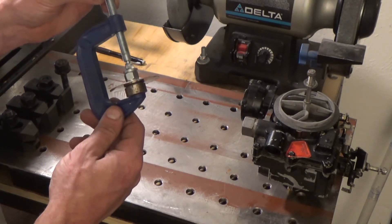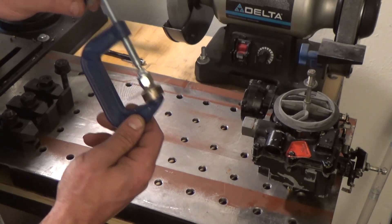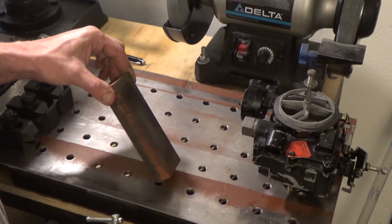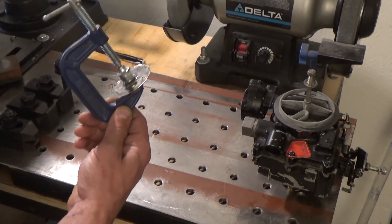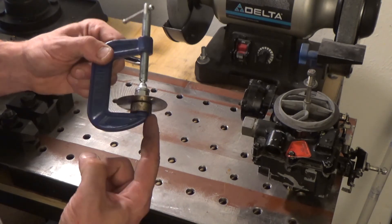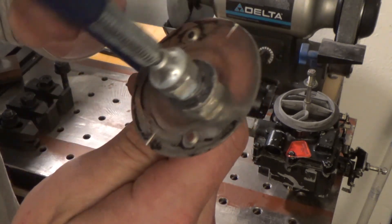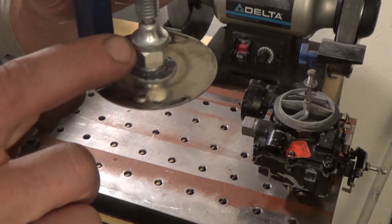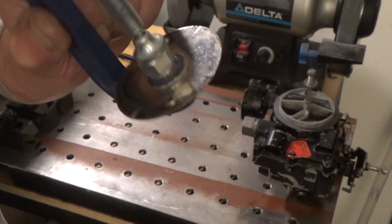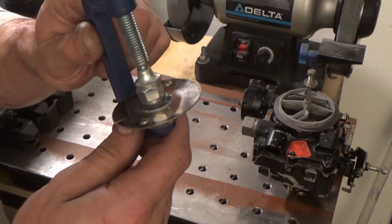After I tested across that resistive disc in the middle, like you saw before - one mega ohm - I'm still getting one meg outside of it. I did take both pads and stone them - not 420, actual stone - and got all the goop off of them, got them all cleaned up, and then decided to JB Weld this on there. There's no JB Weld underneath; the JB Weld is only around the perimeter. I put the nut on, put that piece in the center, clamped it, then applied the JB Weld all the way around with a piece of stainless steel TIG filler.